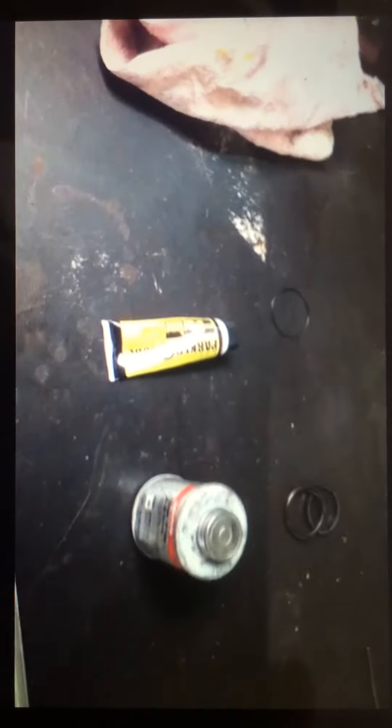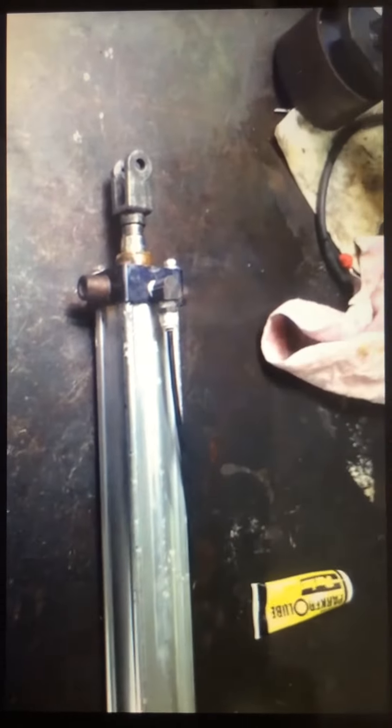Again, we've got our lube which you use liberally inside, and it's used for the bolts. New seals on these end caps — make sure you don't over-tighten them. Specs call for 32 inch-pounds, not a whole lot of torque. There are O-rings there to keep the seal, so you don't have to gorilla-tight those bolts and create problems. But again, this is the finished assembly and it's ready for reinstallation.